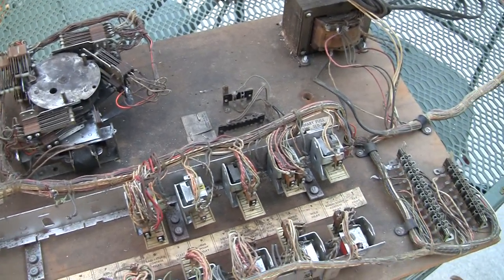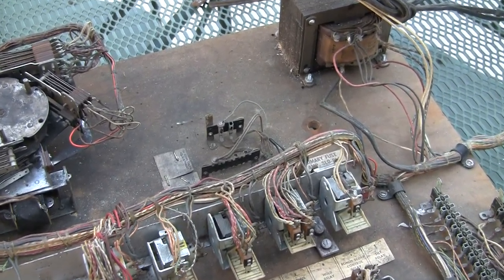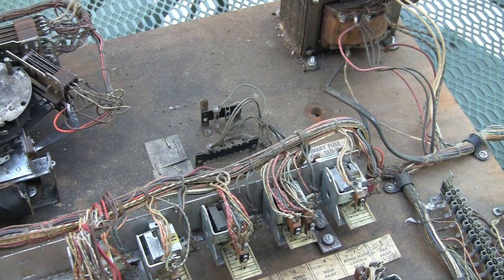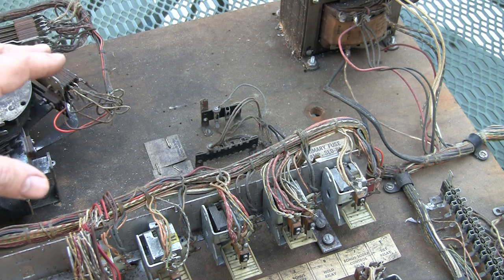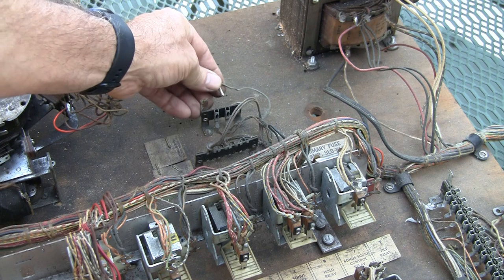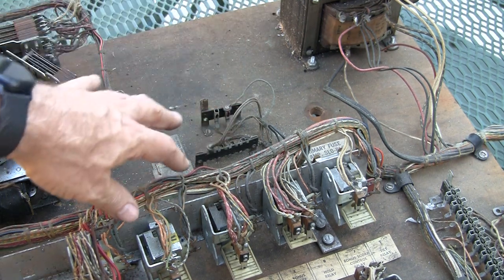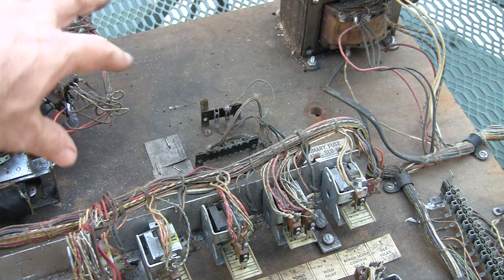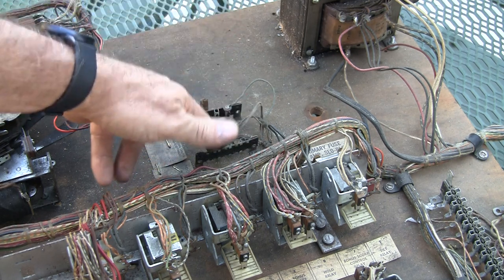You'll often see little mini Jones plugs over here like this. In this case they control the value of the coin mechanisms — is it one coin per game or two coins per game? Depending on how you move this pin from here to here, you can change the settings. Maybe one slot is nickels and one slot is quarters. If it's 25 cents you might want one slot to be one game and another slot to be one-fifth of a game — it varies from machine to machine: two coins one credit, one coin one credit. But you can change the denomination mechanically of the coin chutes that way.